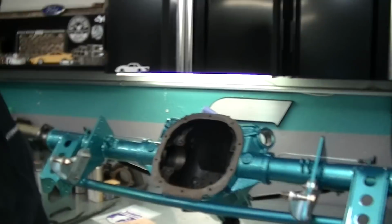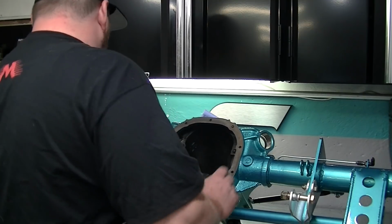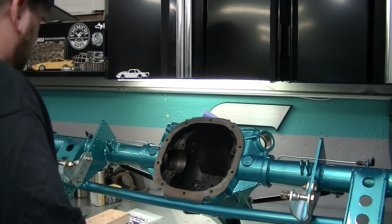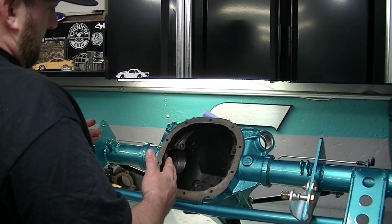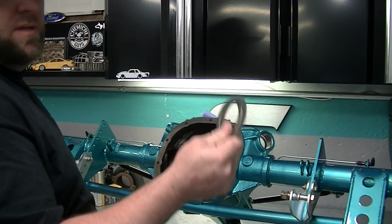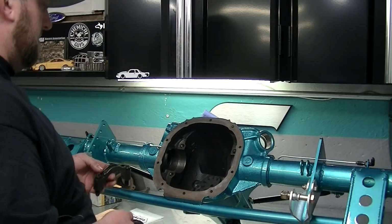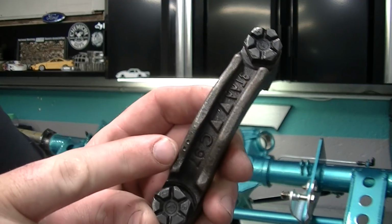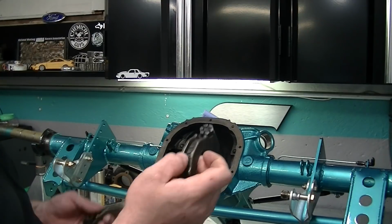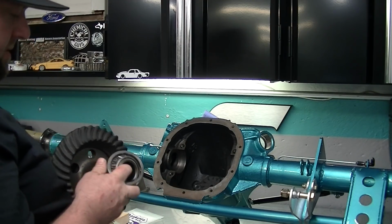You got your pinion in there. There she is. Now you got to put your diff in next and try to set your, don't mind me, I can't think of all the terms right now, but you need to set the diff from left to right. And how you do that is with more shims. Also, another note, when you take your bearing caps out, you want to mark them, make sure they're on the right side. This one, I don't know if you can really see it, 2 punch marks in the housing. 1 punch mark, granted you don't need to do both sides, and they got arrows, you want to face them out. Take your spool, diff, whatever you're using, keep your bearing caps on.